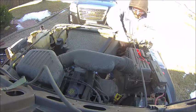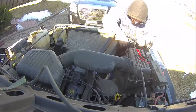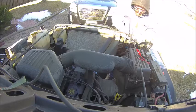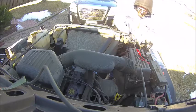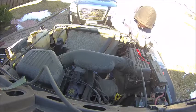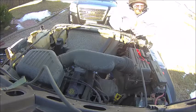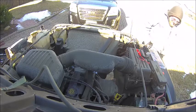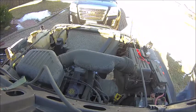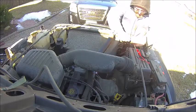Run the wires, pull the zip ties, make sure everything's not touching anything sharp or anything hot. Because of the extensive use of wiring loom on this harness, it's actually pretty straightforward. There was a little bit of wire sticking out just at the connectors, and I wanted to make sure that they were in a position where water wouldn't get to them and where they'd be dry and safe from the elements in general, and make sure that the exposed wire wasn't rubbing against anything.